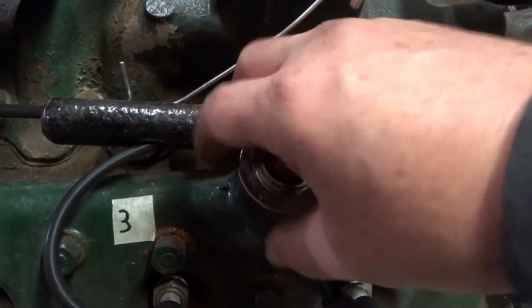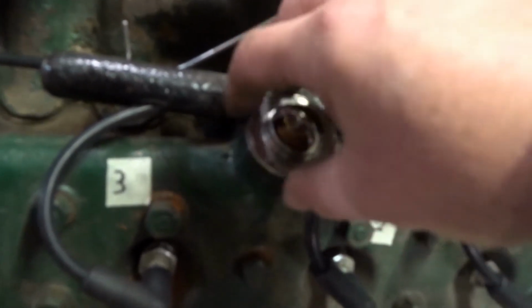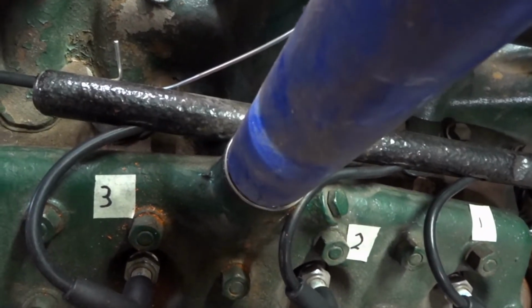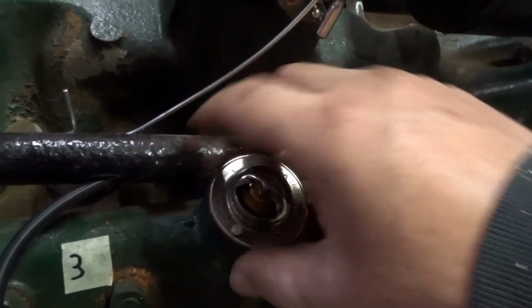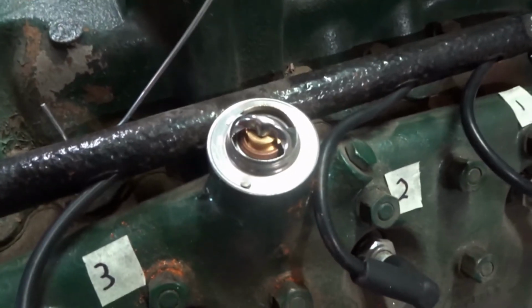So you can put the hose over it, and the hose, when it's done up with the Jubilee clip, should grip it. It does feel slightly wider in diameter than the metal casting, so I would expect the hose to grip it. I could put another Jubilee clip above the lower one and just grip it. The other way is you get a piece of pipe, hose the same diameter, and you put it over it like that, just a short piece, and then you put that inside your larger hose, and it just pushes it down and keeps it down. However, to be honest, I think a piece of squishy hose would actually grip this, especially if I put a second Jubilee clip above the main clamping one. Can't see how this is going to go anywhere. So I'll wait for the 90-degree bends to come and then decide what I'm going to do there.